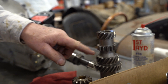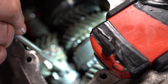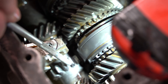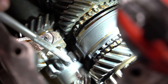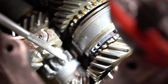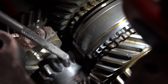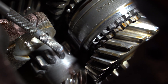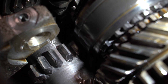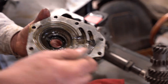But these up here are really chewed. The gear against which this fits when you engage reverse is this gear on the lay gear. Let's take a look inside the gearbox — you can see as I turn this that some of those teeth are really chipped up. The more chipped they get, the more swarf — the more chips and dust and junk — you get swirling around in the oil, and that's no good. This is an overdrive gearbox, and there was so much junk in the oil that it galled up the oil pump — the oil pump ceased working, so the overdrive quit.